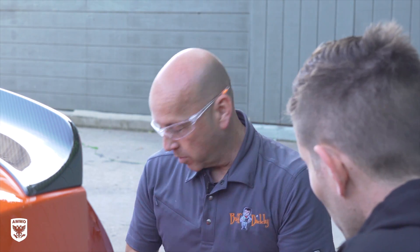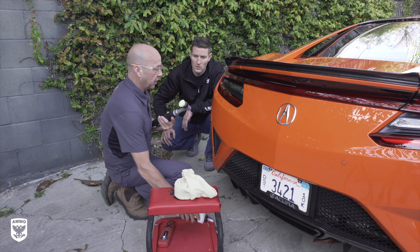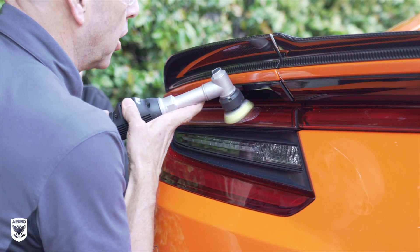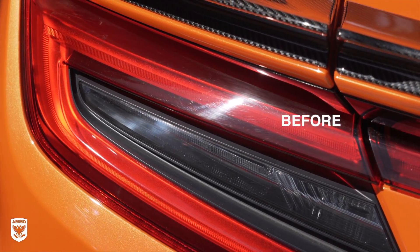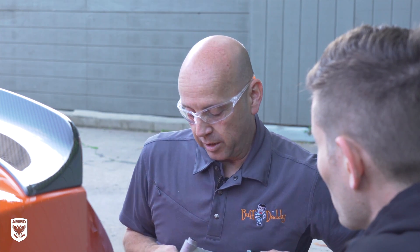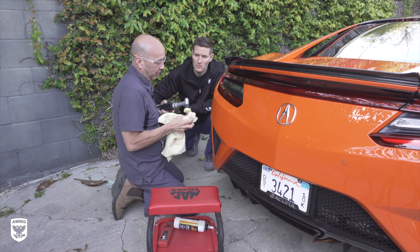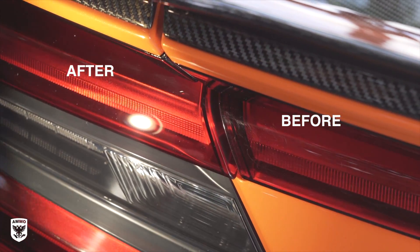If you want to up your game and use some tools, you could utilize a small pad mounted to a handheld drill, or in this case we're using an actual machine designed for tight-area polishing. Same general mid-range polishing pad, same liquid — same things apply as with paint. As you're polishing, you're removing plastic residue, which is contamination or debris, and that's going to affect your cut and your finish. So do a section, clean the pads, and continue to polish until you get a satisfactory result. Keep that residue under control and you're going to get a great finish.